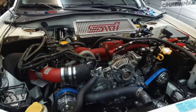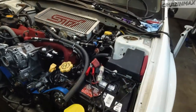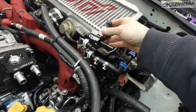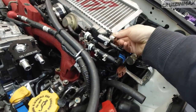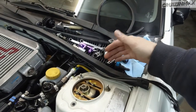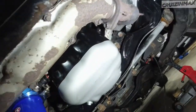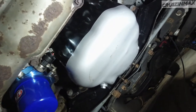It's been about 24 hours. I finished up various things in the engine bay and I'm waiting on the Cobb adapter — they sent me a three-eighths on both ends and what I need is a five-sixteenths, so I'll be able to either hook it up straight to the rail or to this connector depending on room. I called them today — perfect service, no argument, they confirmed the issue, said sorry, and overnighted the correct part. I'm getting it tomorrow. I'm not putting the cover back on anything — just leaving it ready to crank. Everything underneath is done: the cooler, the exhaust, and the two-tone oil pan. Battery is at about 12.4 volts, which is okay.